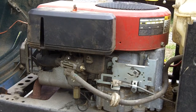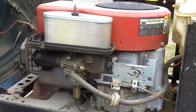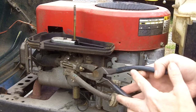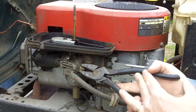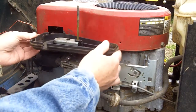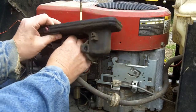To see how this works, I'll need to remove the air filter. And I'm going to remove the air intake manifold. Always make sure you use the right tool for the job. I removed the two nuts, I loosened the bolt here. Now I can slide this forward, lift up the back, and pull this out of the way. It has a PCV breather underneath, which I'm going to disconnect.